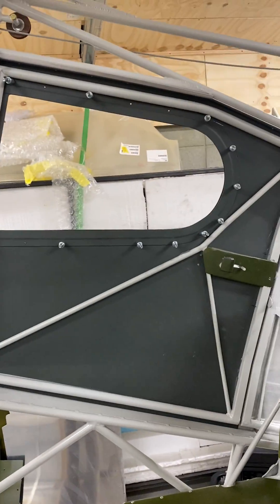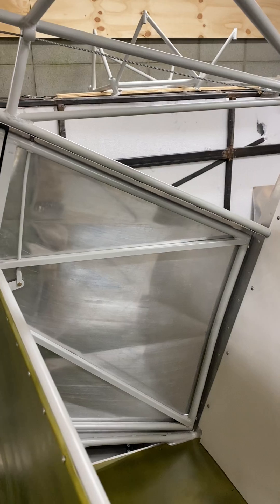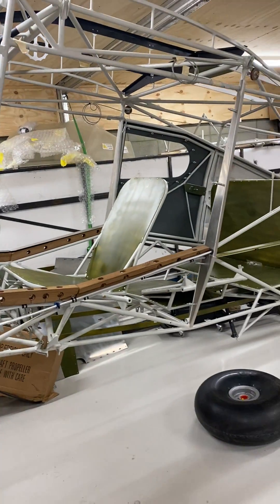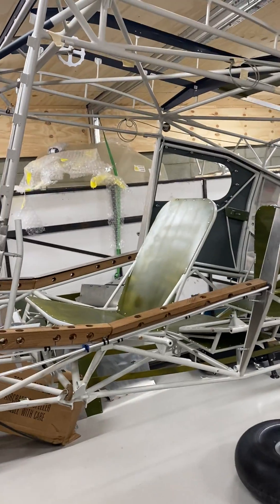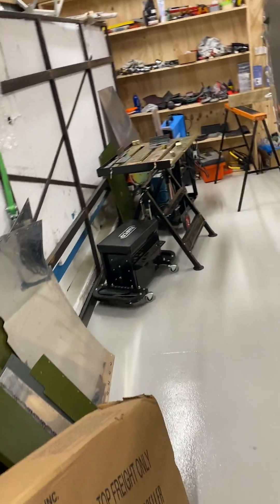One thing I had a lot of fun doing was this forward cargo door. On the rear cargo door I used normal countersunk stainless rivets to rivet the skin in place, and I'm very happy with that — it's come up very well. But I decided to bond the skin on the forward cargo door. Where I'm heading with this is I'm going to make up some gullwing doors for the front, using the standard kit-set top half of the door frame and TIG welding the lower half in place. Then my intention is to bond the Lexan to the frame.